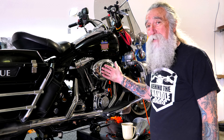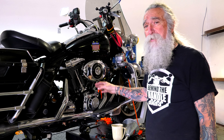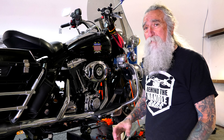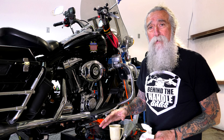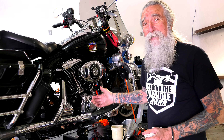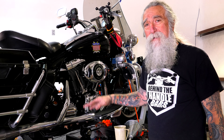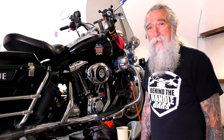I'm going to run the bike for a couple of minutes now, warm it up again, check for leaks, make sure the drain plug isn't leaking, and make sure there's no leak around the oil filter. I'll let it cool down a little bit and check the oil level again. If I need to top off a little bit more, I'll add a little bit more oil. Don't forget I didn't put oil in the filter, so it's going to take a little bit of oil to fill that filter up. I'll check my level again and give it a little bit more oil, bring it back up to the full line, and oil change is complete.